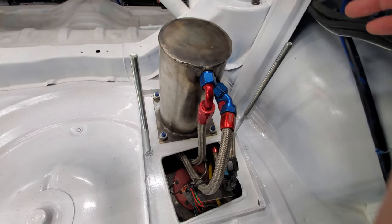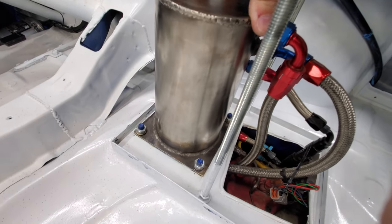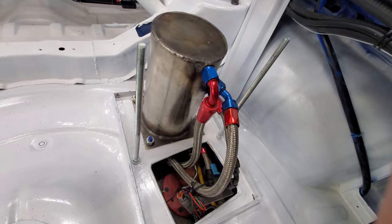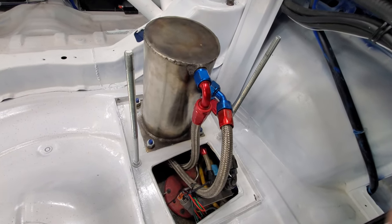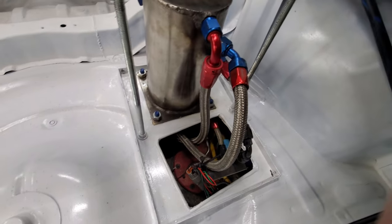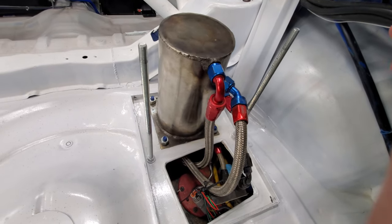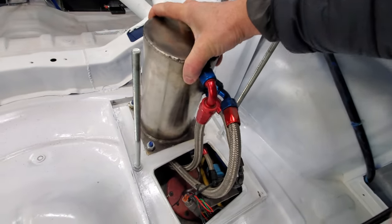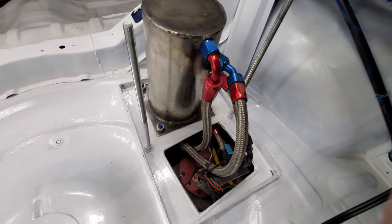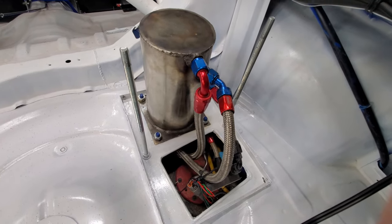The thing to think about inside of these is not only the impact. Anytime you have any hard hit to the car, you don't want the surge tank to be able to move. This guy is literally bolted on a six by six plate. There's another one directly below it, and it's actually sandwiched into the body there — nice, tight fitting. You also don't really want to use the body as a breach area. What I mean by that is you don't want hard fittings attached to the body, because think about what happens if you get in a crash — something's going to hit it, it's going to potentially bend that body or even flex that hose. The way we designed this guy is if something gets hit and this entire piece were to deflect out of the way, well, everything is still on just these soft lines. So that way, less chance of a leak. Having your typical bulkhead fittings go directly through something can potentially cause a problem, and I'm a bit of a safety nut — so that's why I actually decided to go with this route instead of having bulkhead fittings.